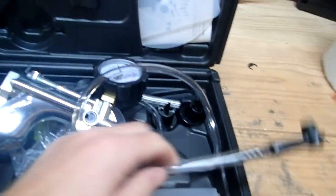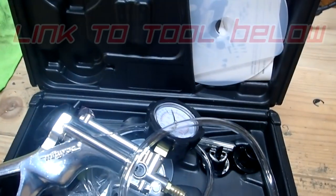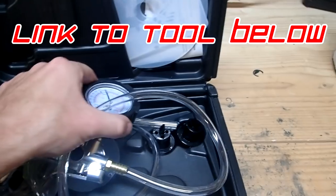On to adjusting the wastegate. With the new fuel pump and the new tune, we're going to be running higher boost — even if you're just doing the normal 2018 tune, it's still higher boost, so you have to adjust the wastegate. The wastegate has a little actuator on it with a lock nut and a screw piece. For 2017 X3 cars, stock wastegate crack pressure is 6 pounds. We'll take off the vacuum line, put on this vacuum hose where that line goes, and crank up the pressure — we should see the actuator move at 6 pounds.